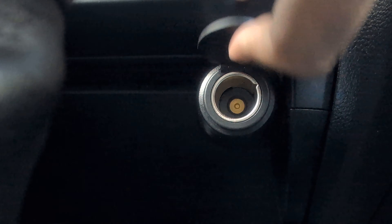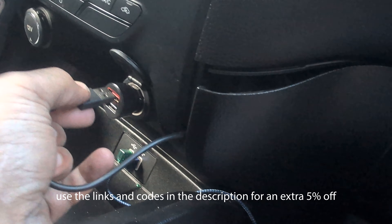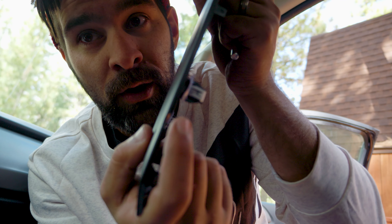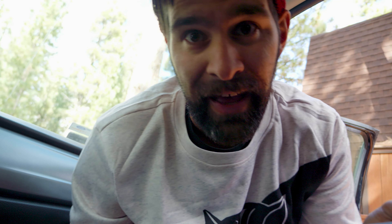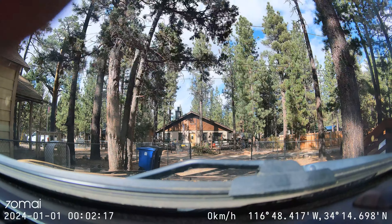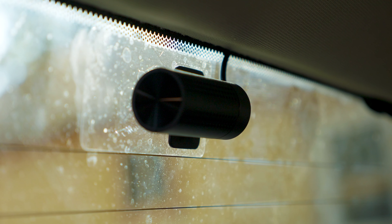The Ranger's not too bad for installs because it's got all these removable trim pieces. If you want to get really fancy with an install like this, I recommend getting an X-Acto knife and notching your trim pieces where the cable's going to come out — that way they'll still lie flush. This version has dual-channel recording, so I'm mounting the other camera in the back. It's also got a Smart Parking Guardian mode. You can power everything by USB-C or hardwire everything.